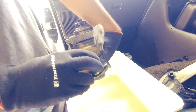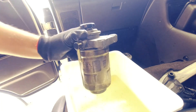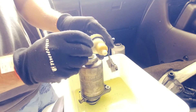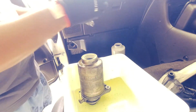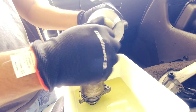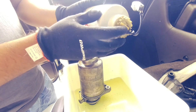That is quite dirty — a whole lot of small moths, or bugs, or flies in there. I've never seen that before. On our water sensor, we want to remove this old o-ring from it, because we have a new one that comes in the box. This one is well crushed and old. We'll pop that in there and pop the new o-ring on. Just thread them on. And this does not have to be gorilla tight — I'm not going to use a tool to tighten it, simply because that o-ring will do its job.